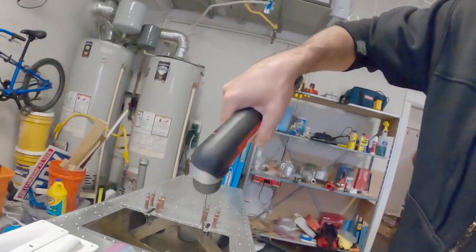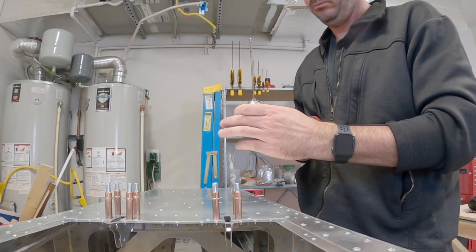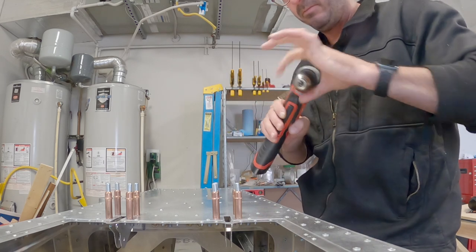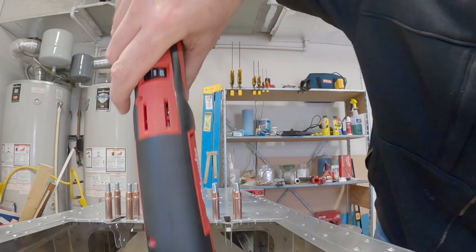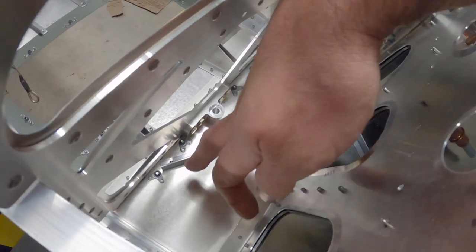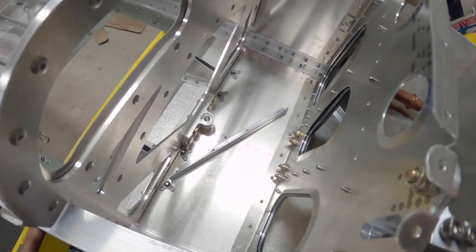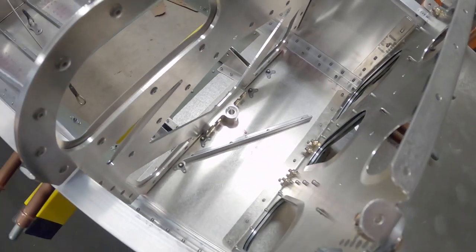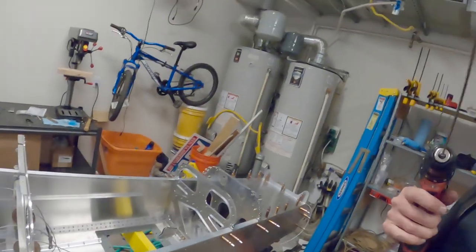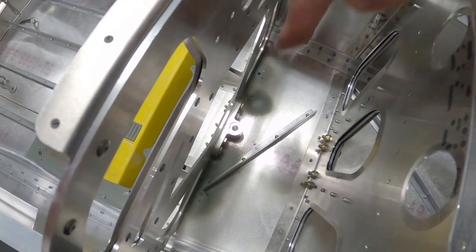A size 12 is going to be too long, so let me switch to the sixer. I've pinched myself more times than I can count on this thing, so be careful as you're tightening it up. I flipped it back over and started locating the nut plates for the end of the tail wheel steering cable exit fairing — going to start drilling with the long size 40. Can't emphasize enough how useful these are.